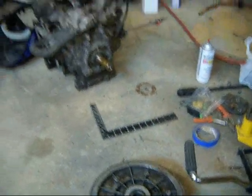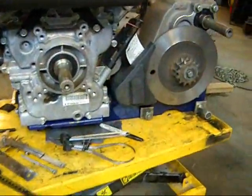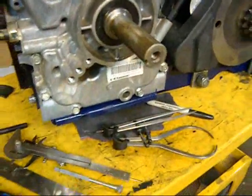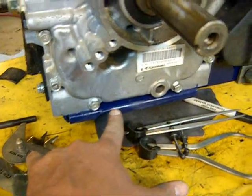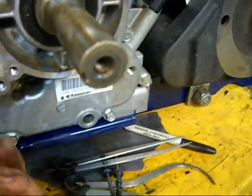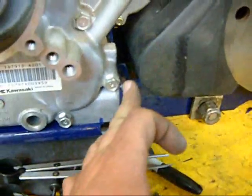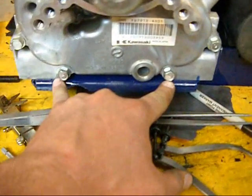Here's where I'm at now. I'm working on this clutch and lineup assembly from the driven clutch and the primary clutch here. My thought process is going like this: this engine is a little bigger than that engine. What's common to this power plate — the blue bracket, the power plate bracket — is common to the transmission that we put on together. The center lines of these holes are common between both engines, but even though the flange had to move back, the center lines are roughly the same.